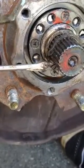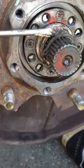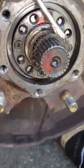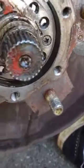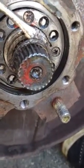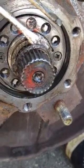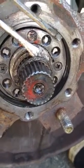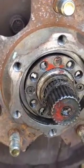And then once you've got these two ends off, you can work your way around with a couple screwdrivers, just gingerly pulling this snap ring off, because I'm sure it's under a lot of tension, and if it breaks, it'll be a bugger to try and find one. Needless to say, it's such a small little part. You don't want to break it and then stop your job halfway through and have to wait a week to get a new piece. But anyways, I've got the ring part way off.